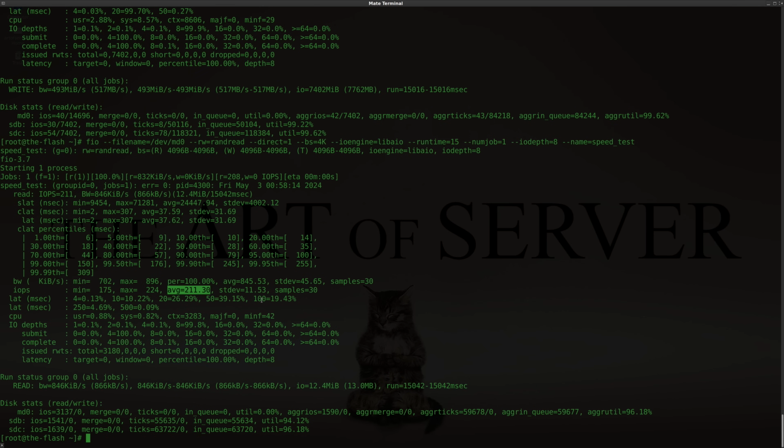But let's say you went with a RAID 5 and you lost those two drives in a RAID 5, then your RAID array would be dysfunctional, right? So that's not good. There needs to be a little bit more care and thinking behind how you're going to utilize the two halves of the Mach.2 drives when you are assembling them in some sort of parity scheme, whether that's RAID 5, RAID 6, or like in ZFS, RAID Z1, Z2, or Z3. So I think additional considerations need to be made when you're using these Mach.2 drives in those scenarios.